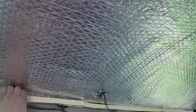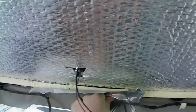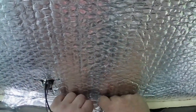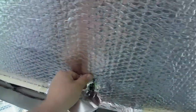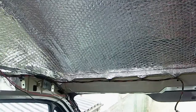This gap here is about 20mm, so I got some Celotex and stood on it and squashed it down until it was about 20mm thick, just to fit in this gap. Because it was such a wide gap, I believe that would be a problem in the future - either with moisture gathering behind it or thermal bridging cold air coming through it. So I took the decision to seal it up. Now we're on to the best part of the job - putting the foil tape on. This is my favourite part, it's just so reassuring and gives a fantastic result when finished. In the corners above the doors, we used earth wool insulation and then covered it with vapor barrier - it's made a lovely, tidy job.